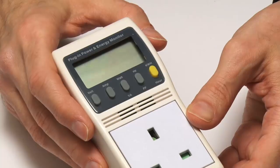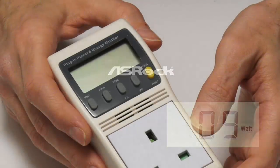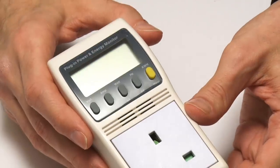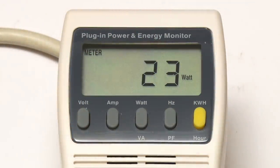You might remember when we looked at the ASRock J4105 build: we had a power use of 2 watts when we plugged in the adapter but before we turned the system on - the power supply itself always takes a bit of power. It's worth bearing that in mind if you're thinking about powering a computer from batteries; you'll need a little bit less power than what we're monitoring here because of losses in mains-to-DC conversion. It's also worth noting I'm going to be plugging this into a computer and not a monitor, but I did test the 24-inch BenQ monitor I often use - it draws between about 22 and 24 watts, pretty typical for a 24-inch monitor.